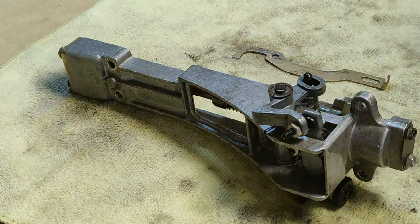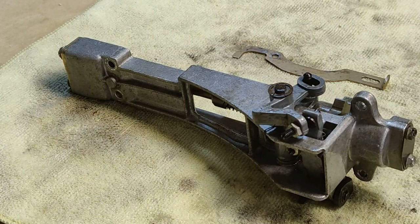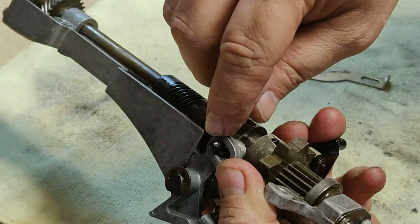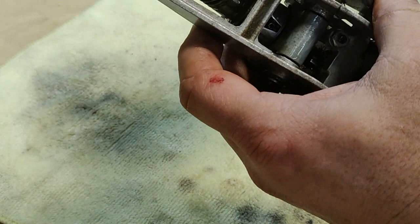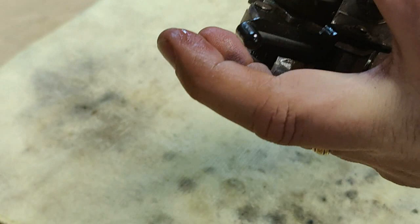We're getting ready to put the safety pin or safety plunger lever back on it. And then we'll move the mech back over and try to get the clutch reinstalled. Keep in mind, although it looks like there should be a place for an e-clip to go here, that's not. That is actually where the spring connects from the trip lever up there. So this is going to go on facing outward, the hook facing out, and that's what moves up and down and moves that clutch up and down into scan and play position.